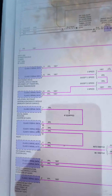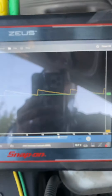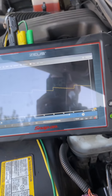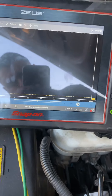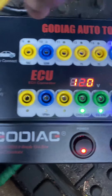The first one I came across was the ABS module. I went ahead and disconnected it, and then my data went back alive. I connected it again, and it shorted out once again. My current power right now is shorted out to 5 volts. The yellow trace — that is not your ordinary CAN signal. If I disconnect my ABS, everything goes back to normal. If I connect this thing again, it'll short out, and then my class 2 data on pin 2 is not flashing anymore — it's down.